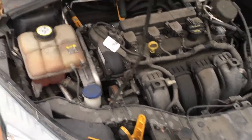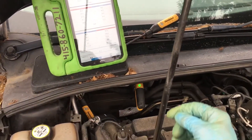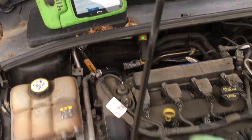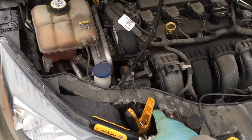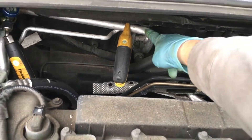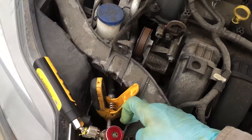We're back on this 2012 Ford Focus, working on the air conditioning. As you can see, there are no traditional gauges but there are all Bluetooth sensors. I have this suction line here so I know the temperature of the refrigerant coming out of the expansion valve from the evaporator. I have the liquid line coming right out of the condenser, so I know the sub-cooling.